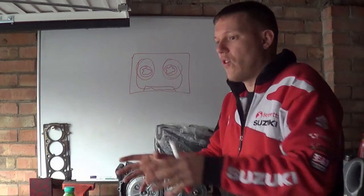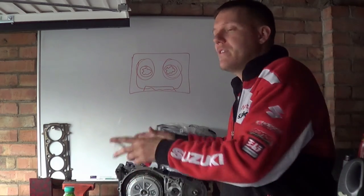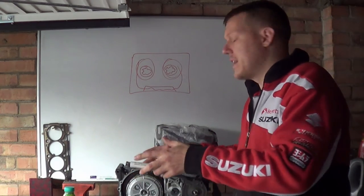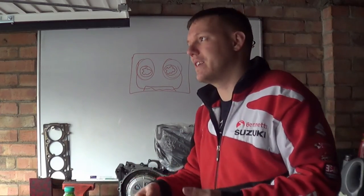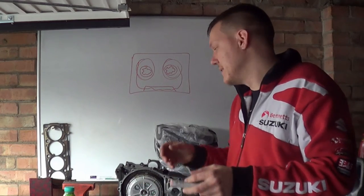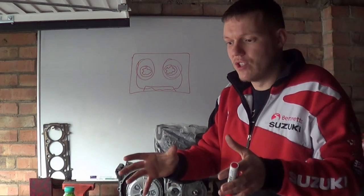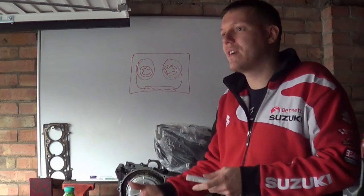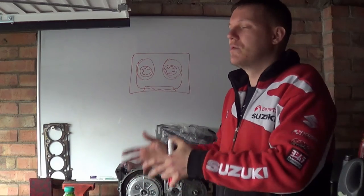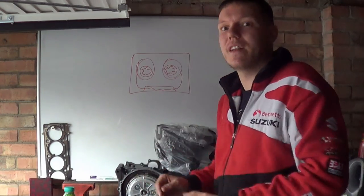The R1 engine is designed for the R1 — Yamaha's flagship bike, and that's what it's designed for. Later on though, you may use that power plant for different applications over the years. The ER5 is a brilliant example: it was in the GPZ500, then it ends up in the ER5, the KLE, the EX500, and so on. That wasn't the design criteria right back when they built the GPZ, so they didn't fit it with a cassette gearbox. Nowadays, engine designers are trying to broaden what an engine assembly can be used for in the future — sometimes fitting a cassette gearbox so they can alter ratios quickly, using the same engine for trials or an endurance bike, just slotting in a different gearbox on the production line.